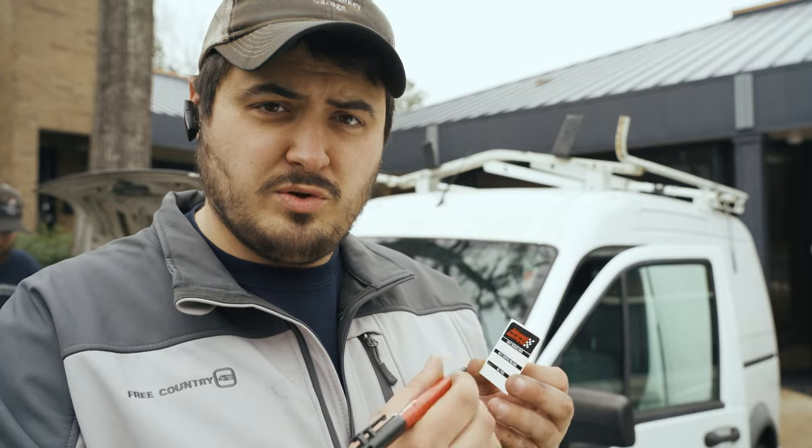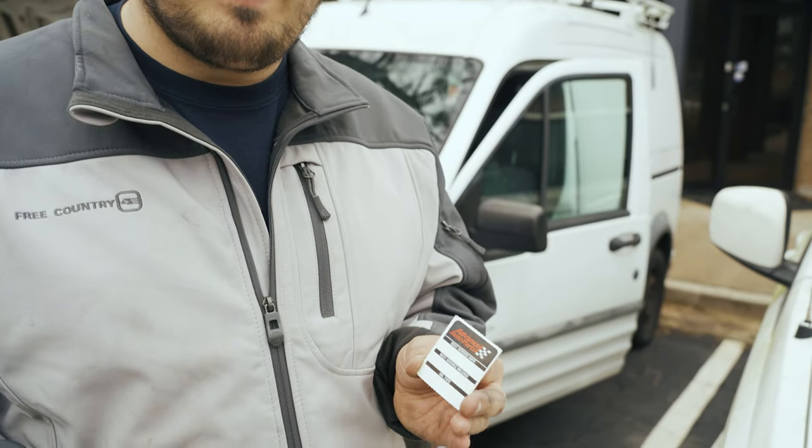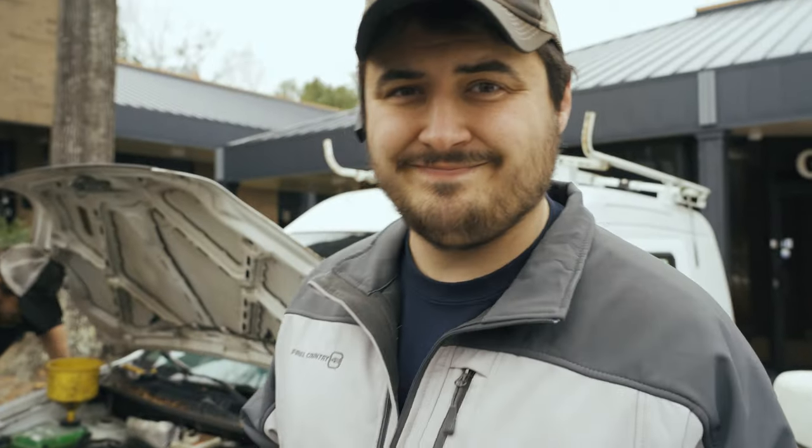After you've confirmed the car runs, you're going to write up a new sticker for the customer's window if your shop does stickers. Put the next service mileage — for synthetic oil we use a 5,000-mile interval, because we want them back in for a tire rotation and oil change. The next service date is six months from that day. So you'll have date, mileage, and oil type on the sticker. Use a permanent marker, stick it in their windshield, and you're done. Thanks for watching Grumpy Monkey Garage — be sure to hit that like and subscribe button.